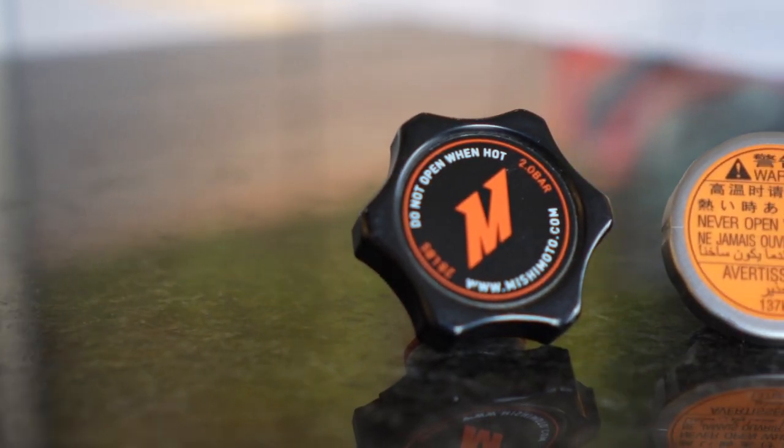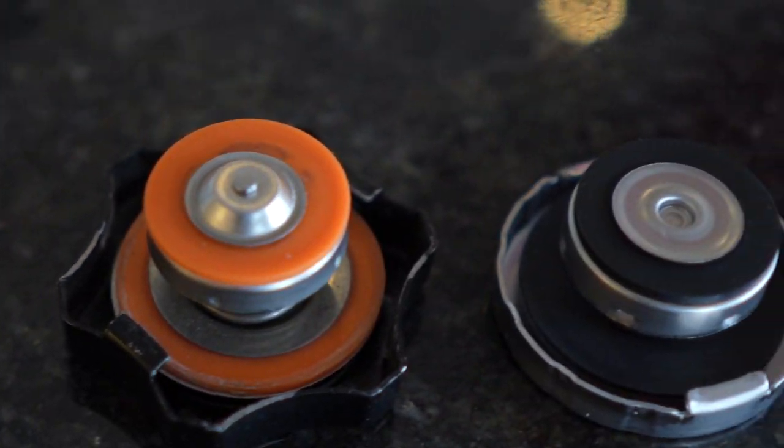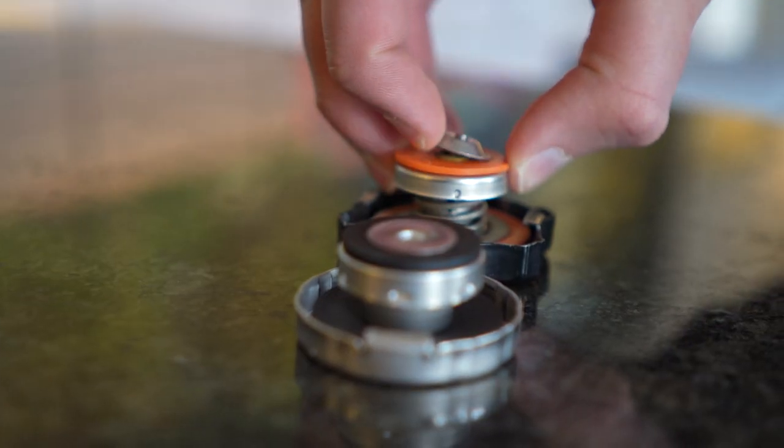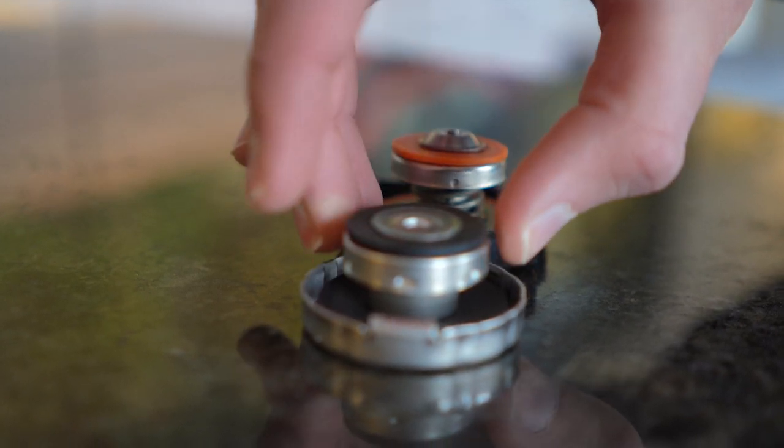So Nigel, what is the difference between a two-way radiator cap and a one-way radiator cap? One has one valve, one has two valves, but they look almost identical. The difference is that the one-way cap — the one supposed to be on the radiator — can only open to release pressure. That's it. Once it closes back down after releasing pressure, its job is done. That is the brown cap on the radiator from the factory. A two-way cap has a little dome on the very bottom where it goes into the fitting. If you pull up on that little dome, it opens up — that is the second valve. That is what makes it a two-way cap.